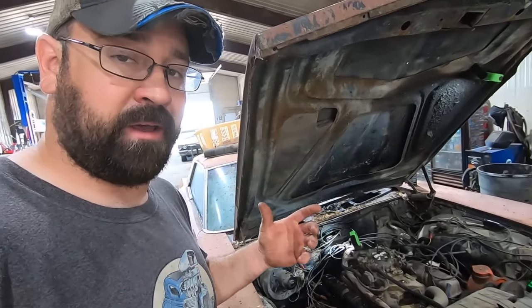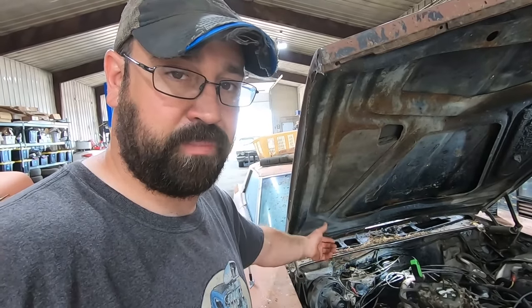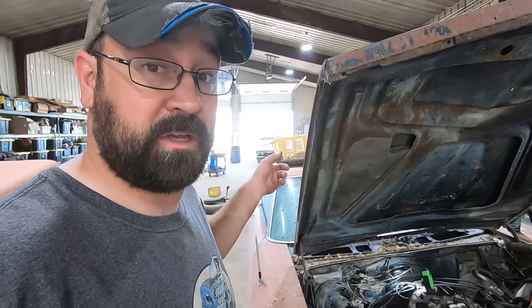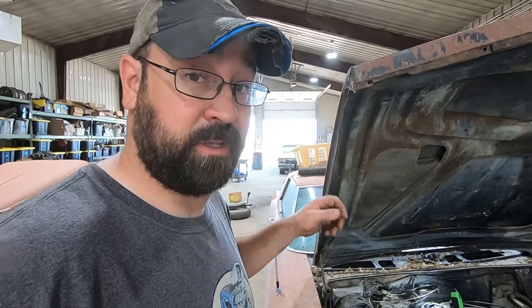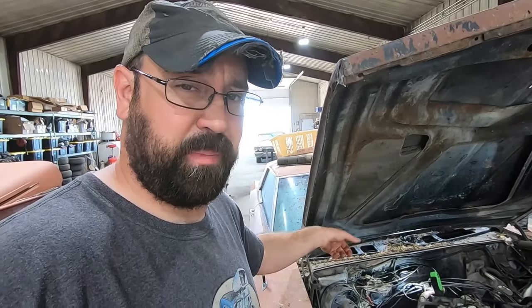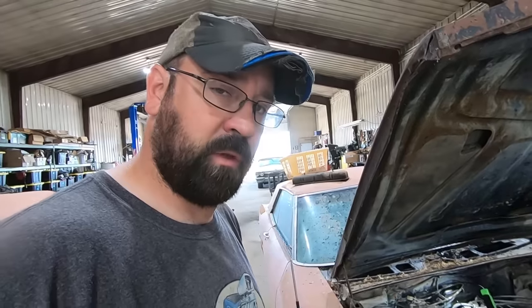And then I don't have to go and try to take out the T that they got in there and re-plumb, because they still got the oil pressure light hooked up, which was off on the dash, and it does work because when you turn the key on, it was on. So we know we got oil pressure, so we're good. And it's just really hard to get down there. It's a pain to work on this oil pressure fitting. So we're gonna actually have a gauge.